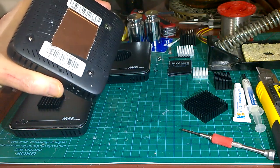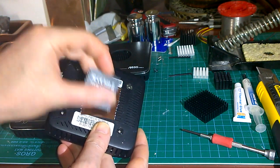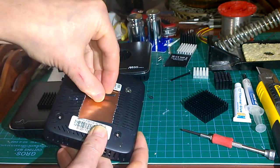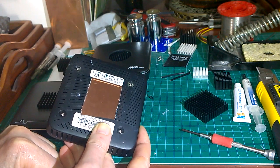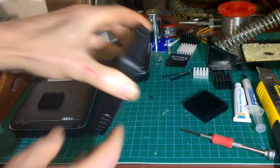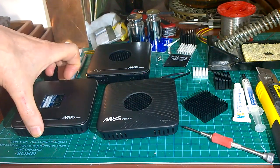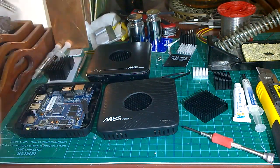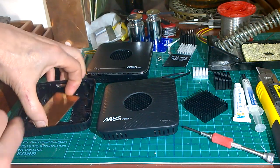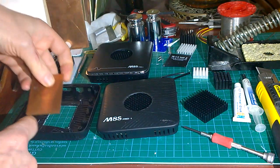I've also started putting holes in the bottom and fitting either copper or aluminum plate there. To cut it out, you cut the square bit in the middle by going along the edges where it joins, plus a couple of small sections top and bottom. A piece of copper or aluminium that is 65mm front to back and 45mm side to side fits exactly between the mounting holes for the PCB. Pull it apart and you can see where it goes - you just plonk it in there between the posts.